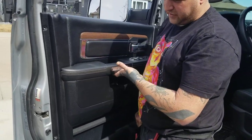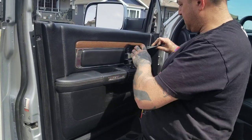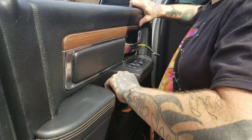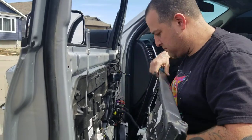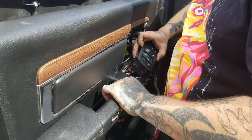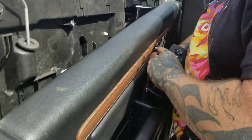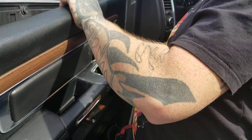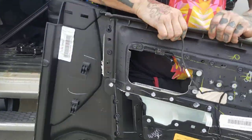You've got the one screw there, panel lifts up and comes towards you. Take this off, unplug the wire clip here. For the button panel, push up from the front — it comes out. There's a little clip in the back, and one more right here. Panel off, put her down.